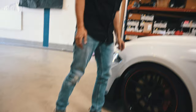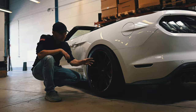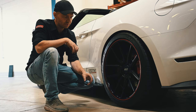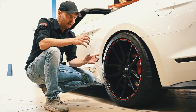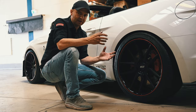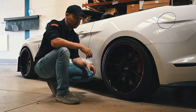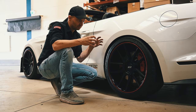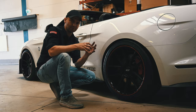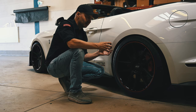On the rear, the wheels are even wider — 11 inches — and they fill the entire wheelhouse. The rear brake system also has a forged monoblock caliper with four pistons. However, we did not integrate the handbrake into that caliper as the factory does. Instead, we have a separate handbrake caliper, because it's better to use dedicated components for different systems: a cable-driven handbrake and a hydraulic foot brake should each have their own caliper doing their job at its best.